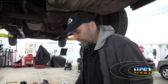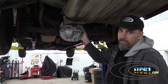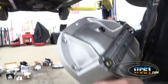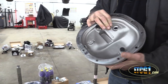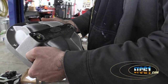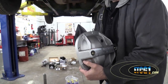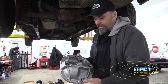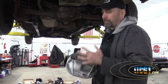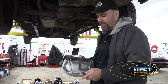I'm going to do basically a series of videos on rebuilding this rear differential. Now you're thinking, Eric, that's just bling — and in a way it is, it's going to look pretty underneath there. But there's more than one reason. These little stops that come out inside here — you tighten these down and they can actually help secure the bearing caps that hold the differential in place. The reason why I'm beefing up this stuff: I'm using a manual transmission. A manual transmission will send massive shock loads through the drivetrain, so the tighter and more right your drivetrain is, the better.